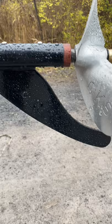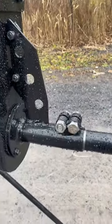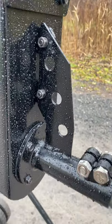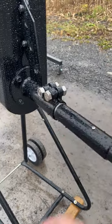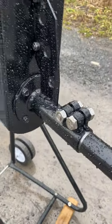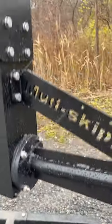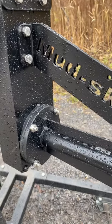The SD300 has a smaller skeg — the fin underneath the propeller which keeps you off rocks on the bottom. Two bolts tighten the tail into the main housing, and the unit has a support brace going to the PTO housing on the tail. One thing to note is that because it tightens down those two bolts, it has the potential to wiggle a little bit back and forth occasionally if you don't have them tightened enough. The 13 horsepower light has a much longer reinforced skeg and a bracket that tightens from the main body all the way down to the center of the tail, so the tail assembly is firmly bolted with no chance of wiggle room.